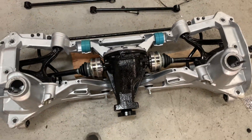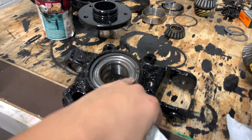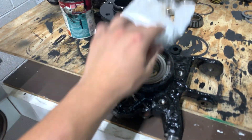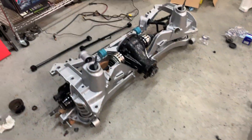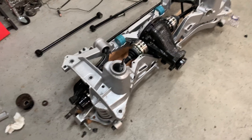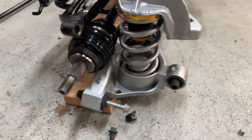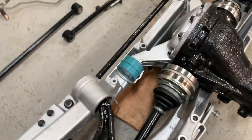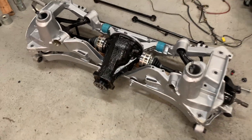This thing is looking awesome — little preview here. We're waiting on a couple more things for the hub. I put new bearings in, the new snap ring in, and I'm just waiting on new bushings. Once those arrive we can press everything back together and put the whole subframe together. I also bought new bolts to torque the CVs to my billet 4340 companion flanges that I designed. My custom bushings are nice and solid, and a little lip stops it from moving axially too much.